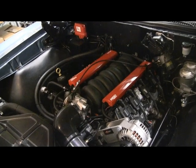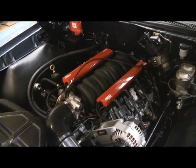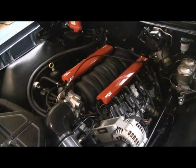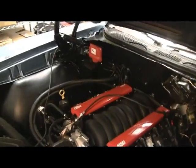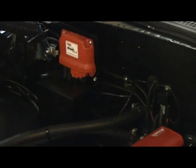The oil has been changed twice — I'm still on non-synthetic and need a few more miles before switching over. I also pulled all the plugs; they all look really good, a nice light brown color, so everything seems to be burning fine. A couple more confessions: on the firewall there's no more tach adapter, because my tach was not reading right and I couldn't figure out why.